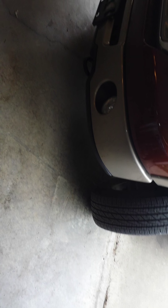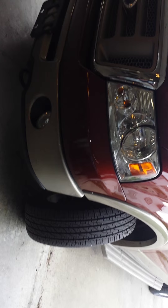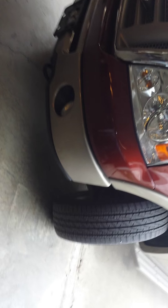I wanted to upgrade these fog lights because with the regular halogen lights compared to the ZXE headlights, there's obviously going to be a color difference and a brightness difference on the road. Some people are sensitive to that, and it could offset you. Also, the ZXE draws more wattage and power, runs hotter, and it might cause an unbalanced current in your harness, which is never really good. But if you have the same brand — the ZXE — the power consumption is going to be balanced, which keeps your harness happy.